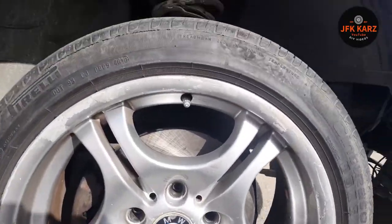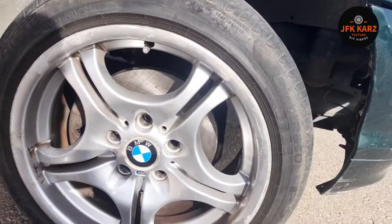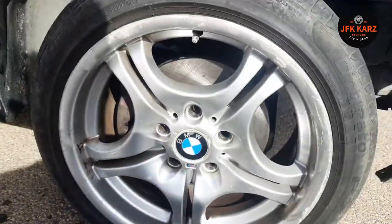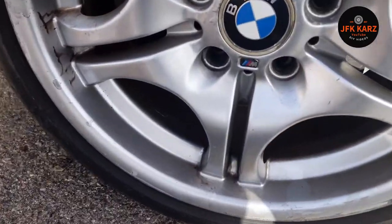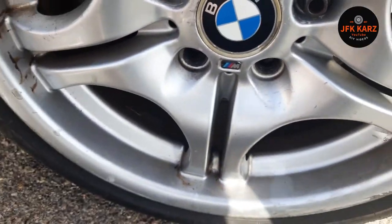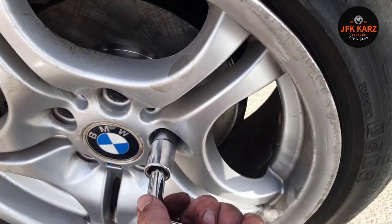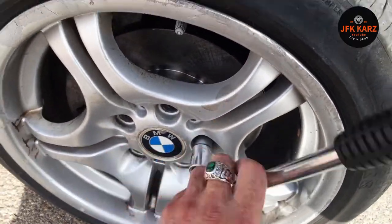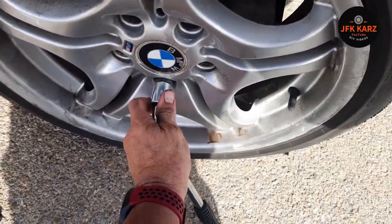When you're putting your wheel back on, you've obviously got to line it up with the holes. It can be a little bit more difficult with the front wheel because the front brake and disc will still rotate, so make sure you wear a nice pair of gloves because you will get quite dirty, and it may require two people. Try to use one bolt first on the hole it lines up best with, get it in to start you off, and it should pull the wheel into line. Get the wrench on that and it will start you off and line you up with the other holes.